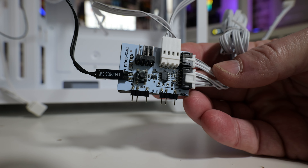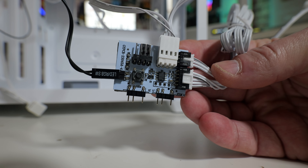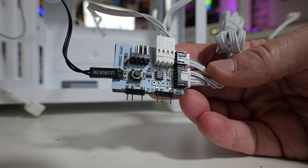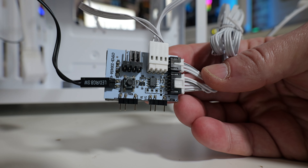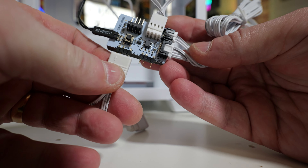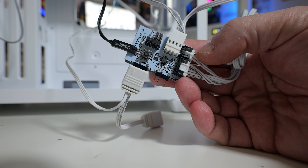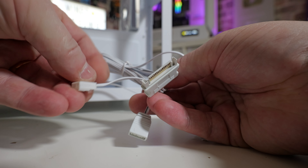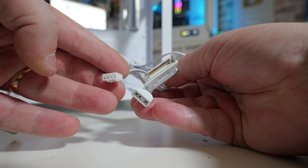Also in the back, we've got a very basic but actually very functional hub. This can take two PWM sources and also two addressable RGB sources. There's also a push button on there with a two-pin connection, so if you want to change the RGB lighting using this hub rather than your motherboard's built-in hubs, you can press that button or the reset button to toggle through the colors, of which there are numerous. When it comes to actually powering the hub, very straightforward — just using a SATA connection from your power supply.